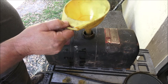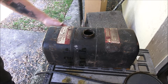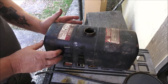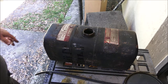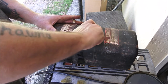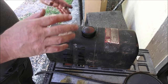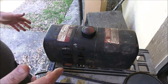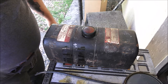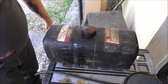Very expensive stuff, but I've got to get new anyway. I've got the petcock sitting down in one of those holes so it'll set straight, and we're going to let it set a while — a couple weeks probably — and see if it helps. Then once it's all clean and dried out, I'll put some nuts and bolts or something in there, wrap it up, put it in the dryer on fluff or air — no heat — and just let it tumble, just like we did on the scooter a couple years ago, and get it all cleaned out.